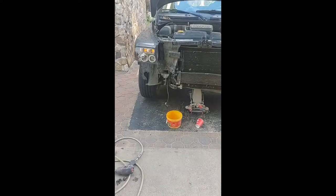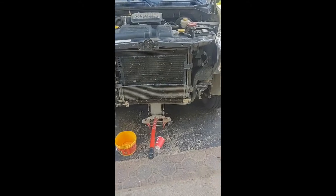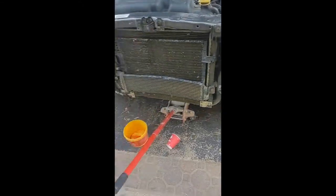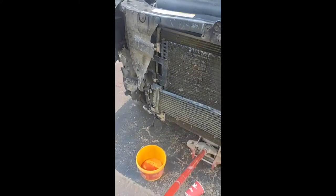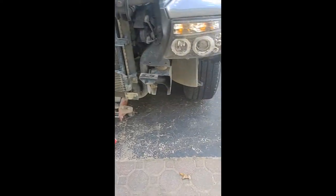Hey, what's up, this is Ryan ripping apart the bumper. The transmission cooler has to come off because it's vented into the radiator — you can see it bends in and doesn't have any room behind it, looks like a U. I took my transmission cooler lines off and have it dripping into a bucket.